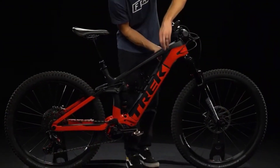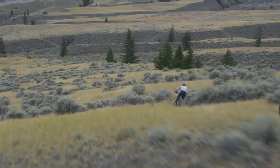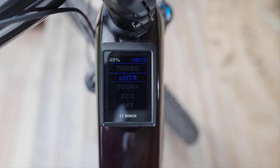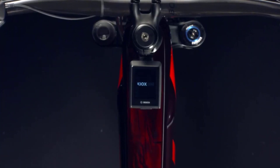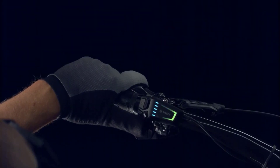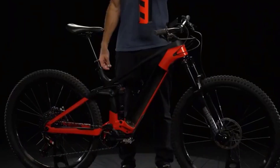Operating the many small buttons on the remote takes some getting used to. All the cables running from the cockpit are routed into the frame via ports just behind the head tube. The head tube on the Trek Rail is quite burly, though it blends in nicely with the bike's silhouette thanks to the 1.8 steerer tube and the oversized crown of the RockShox ZEB fork. Trek have fitted their Knock Block 2.0 in the headset so that neither the display nor the frame gets damaged by the handlebar or fork crown in the event of a crash, allowing you to turn the handlebar by a maximum of 72 degrees in each direction.